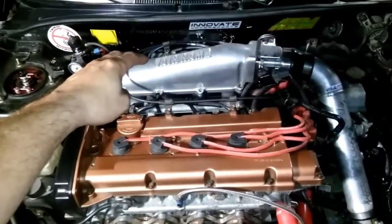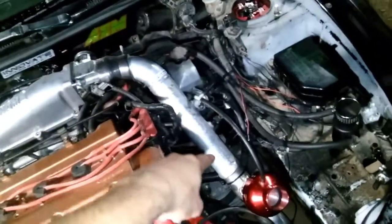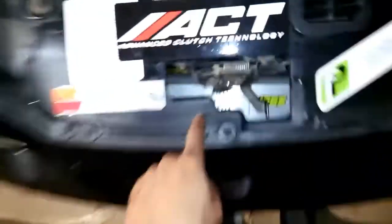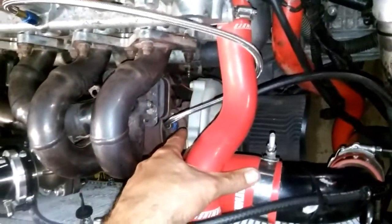Then we go to the air ram. Then you go to the R side throttle body. 2.5-inch Vibrant pipe down to some cheap eBay crap. Alpha blow off valve from Tial. Crappy eBay intercooler that keeps the inlet temps way too hot, because I've been too lazy to flip this damn thing off each time I've had the head off, but whatever, we're still making 400 horsepower that way. Inlet temps are like 110. But not too bad. I've seen worse.